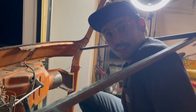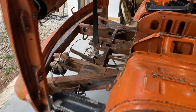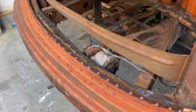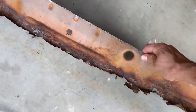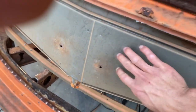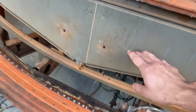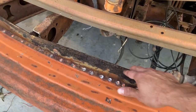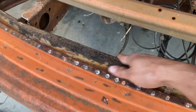We bought it. So do you want to find out how we're gonna make this floor work? Well, me too. So far what we've done is cut out this rusty part here. My theory is that it rusted out because the hose that catches the water from your fresh air vents is supposed to drain out. It was just draining straight in here. It was making puddles.